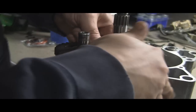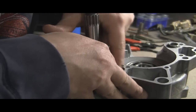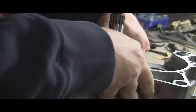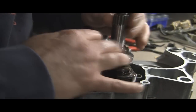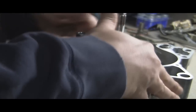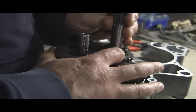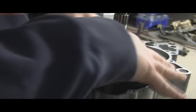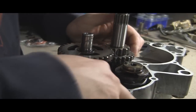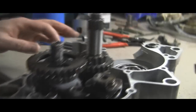This is the only thing that makes it difficult on this side. If you can get it in one shot it's a lot easier, but it's hard to get it in one shot. We just got one gear a little hung up here — we need to get it raised, and I think it's in the middle of a shift so we're not able to do that. There we go. All you've got to do is just spin the gears to where they line up. Now we've got them all where they need to be on the shift drum.